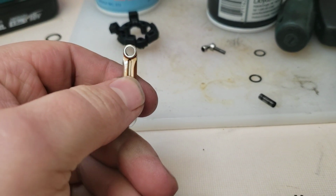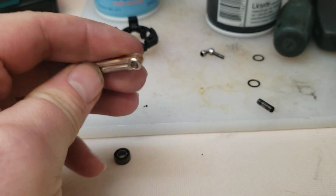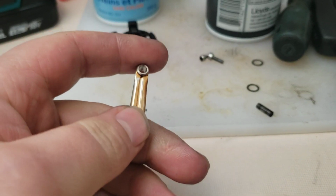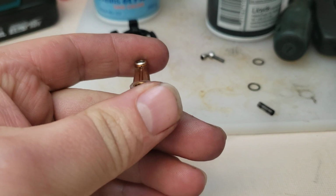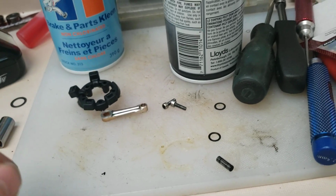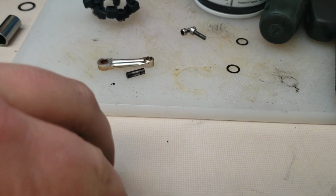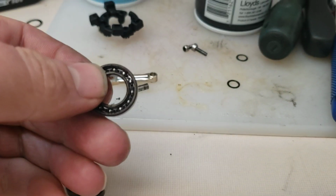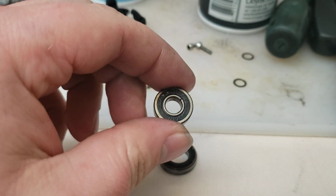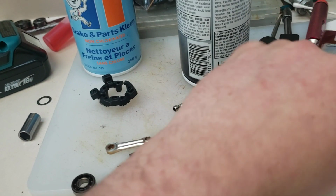Here's the worn out connecting rod out of that 2.5R. And I think I explained before, the 2.5, 2.5R, and 3.3 all use the same rod, so one's not stronger than the other. But this wrist pin bore is all worn out. So that's a keychain ornament now. Worn out wrist pin. Of course, the front and rear crankshaft bearings, which are all sloppy and gross. We replaced those with some Fast Eddies, which are right here.